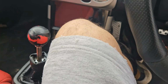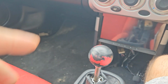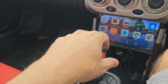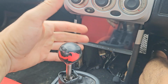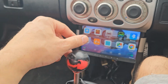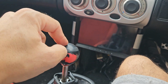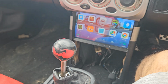Sorry. You do have on the 6-speed, where reverse is, you put it in reverse, you get a beep. The reason for that is because it's very easy to go from when you're slowing down to go first. If you go, it's quite easy to go like that. Now it doesn't seem easy when you're here, but it is very easy to go like that. And if you didn't beep it, you quite easily reverse into the car behind you. Because it's not like you've got to push it down or pull it up, it literally pushes over into reverse. So be warned of that. Some people ask to take the beeper off. I don't think it's a good idea because it's too easy to put it in reverse by accident.